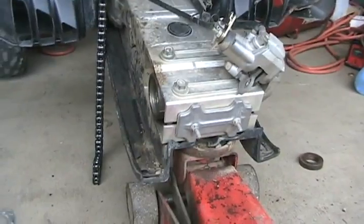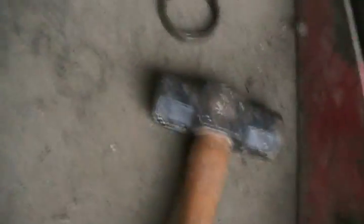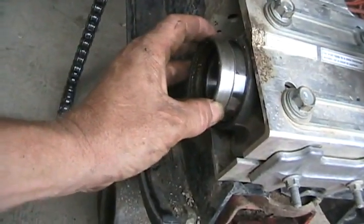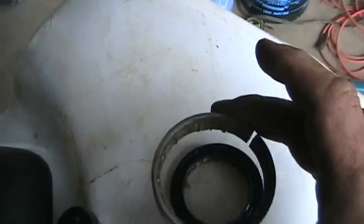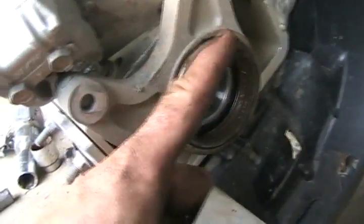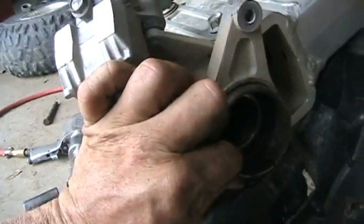I've just set the bearing in there by hand. I found a little block of aluminum - you can use steel - and just spank that puppy until it's level and poke it in straight, then put the metal plate against it and push it in the rest of the way until it hits bottom. Remember, never hit that surface. Now for the next side - that piece of old bearing also makes a perfect seal installer. When I tap that in, the bearing didn't quite hit bottom because my piece of old bearing didn't stick out far enough, so I added the other old bearing on top, used my little plate, and pounded in the last millimeter. That worked out great. Now to put the new seal in the same way.